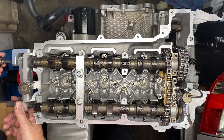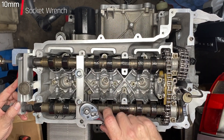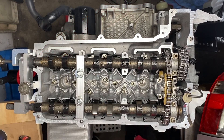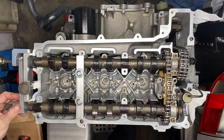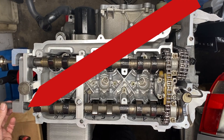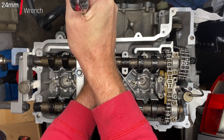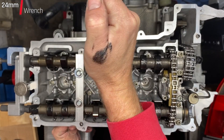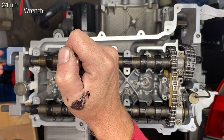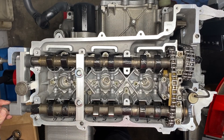We're tightening tool 9612 onto the end of the exhaust cam and the brace — you're not really tightening it down, you're using it to get the height right so the tool can slot into the end of the exhaust cam. Then we're going to use a 24 mil to lift that tool up and push it into position right next to the intake cam, then pulling it back down until it lightly touches the cylinder head.